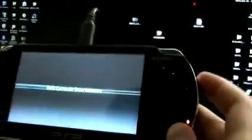Go ahead and wait for it. Once it gets done flashing, it may just sit there — leave it for a whole other minute afterwards. In our case, it actually just rebooted automatically. Then it'll act like you've got a brand new 1.5 PSP: it'll ask you to reset your time and date, the name of your PSP, and all your settings. You may or may not have a UMD load error — we did, so we had to take out the battery and leave it for five minutes, just to make sure all the power is totally gone from the PSP, then put the battery back in and turn it on. UMD works just fine. And it'll tell you — if you're using GTA — that you need to upgrade to 2.0, because now you have a 1.5 PSP.